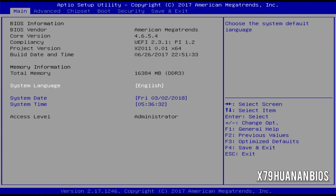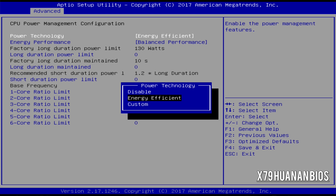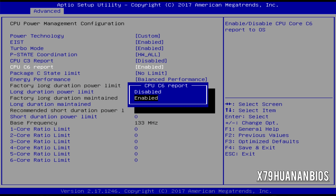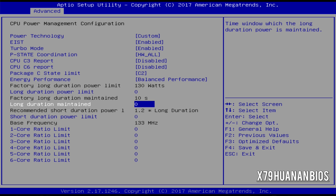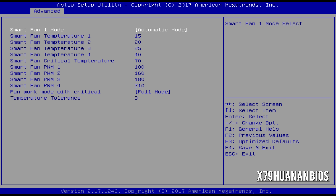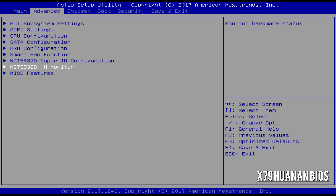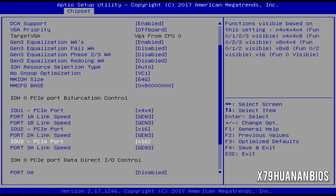The reason they go with that H77 chipset is twofold. First, the license is a lot cheaper than an X79 chipset license. The second thing is the H77 chipset is not overclockable, and that's actually a benefit for the people making these motherboards because they aren't putting the best VRM on them. That means they can get away with saving money on the license and also capping the overclocks. This board will cap the 1650 to 3.9 gigahertz. I went into the BIOS — it reminded me of a server BIOS. You did have options to change some memory settings, and you could force it up to 1866, but that depends on the kit of memory you get. I managed to get my memory to 1600 megahertz across four sticks on registered memory, which is pretty good.